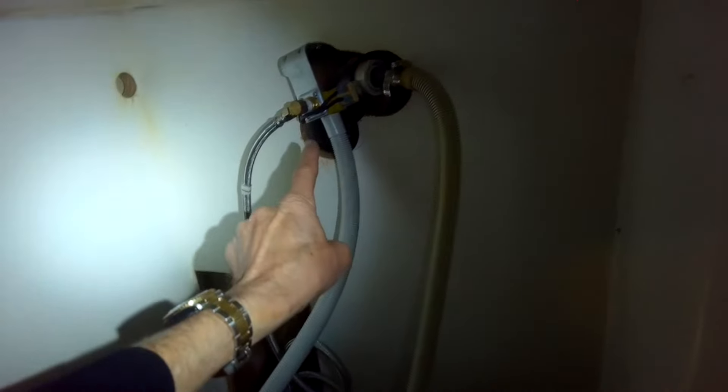You've got your connection to the line and your wires done. We just have to connect it now to the water supply — just add the other end of the silver fill line to the faucet underneath the sink, or in this case the faucet behind the dishwasher. We can turn the water back on, plug it back in, put the dishwasher back in the cabinet, and you'll have a dishwasher that fills correctly again — doesn't overfill, doesn't underfill. Thanks so much for watching. I hope this video saved you some time and money. If you have any questions about this repair, contact me at scottthefixitguy@yahoo.com. Thanks again and we'll see you on the next one.